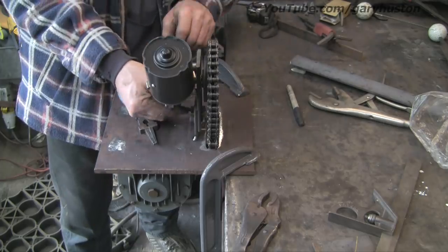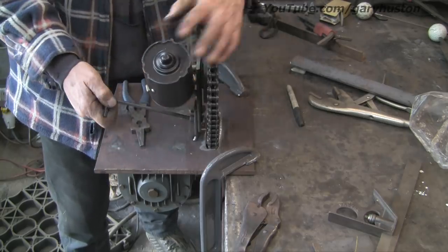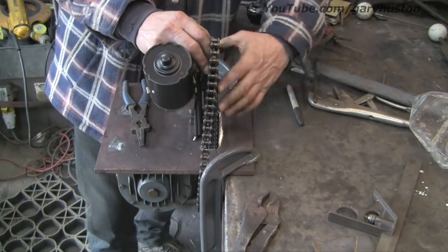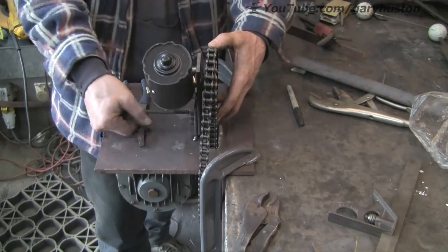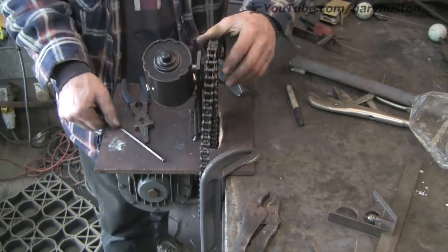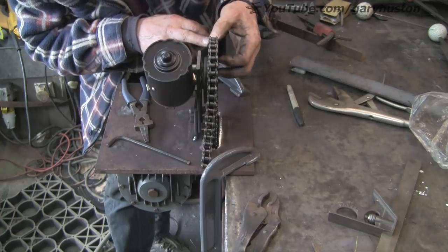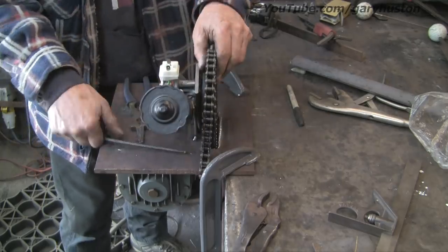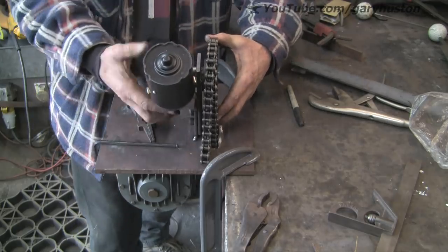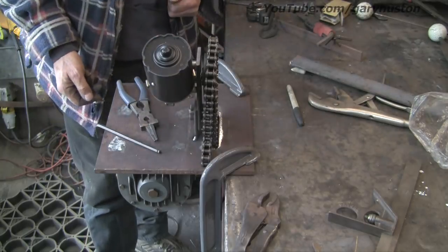Let's slacken her off. That's right down now — see if that helps. I'll go back onto the next tooth. I don't think that's going to work either — that's too far the other way, so let's go up. I'm so glad I put those slots in now. If you've used chain a lot, you need to find a flat bit — the joiner link has got to go on two flats. Anyway I think I've sussed it — I'll just cut the chain off. You can see there the two flats are the same.